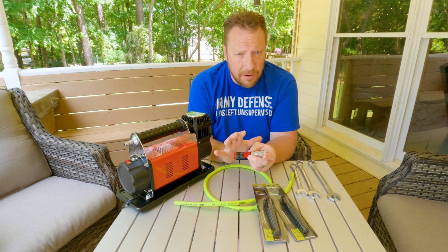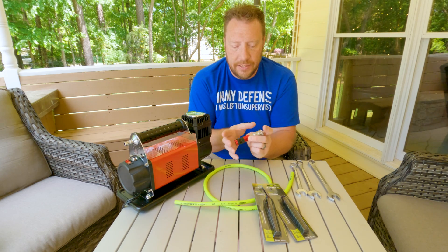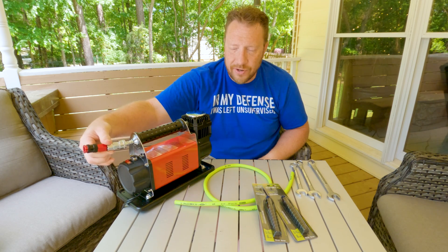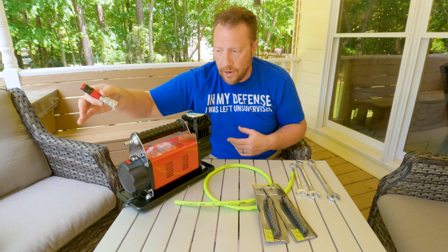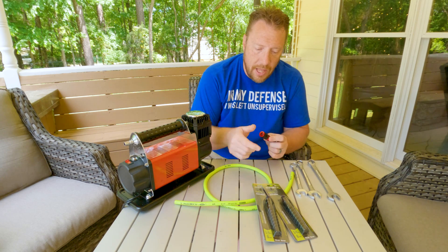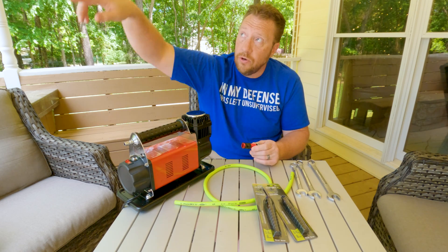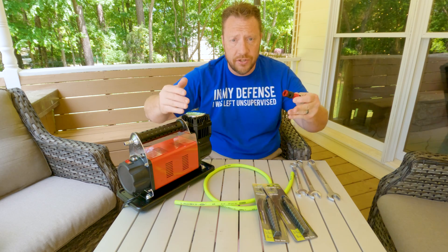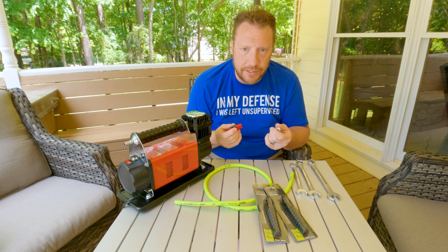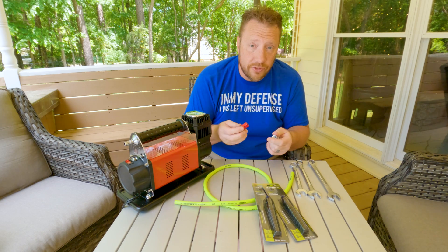What I don't like about that rigid setup with this compressor is — with it being real rigid, you plug that into the end of the compressor and now there's a lot of leverage, and I'm just worried that if something slips, falls over, or gets yanked on too hard, it may break this fitting coming out of the compressor. If I have an extra little length of hose, the compressor can sit on the ground, the hose can go up, and I can have my inflation system set up on my bumper and just run this quick little hose up. In my opinion it just makes things easier and a little bit more secure so that you're not breaking fittings — everything has a little bit of give to it.